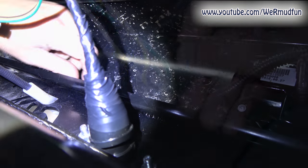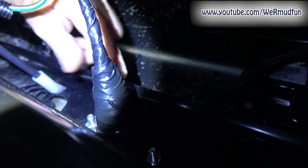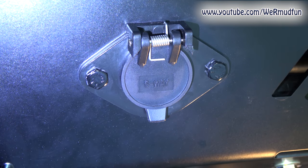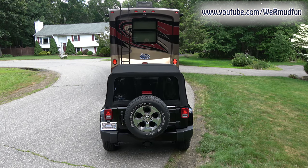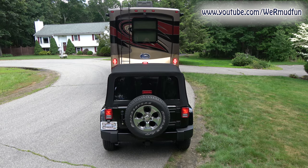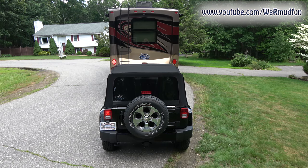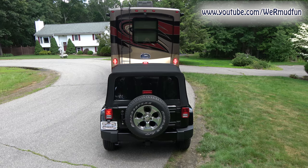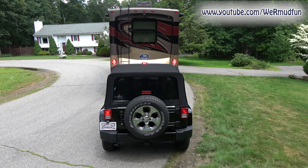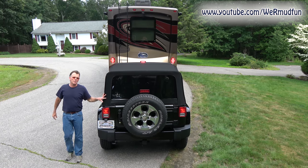That's our little cheat sheet — that's our finished product. It's all installed, the wire boot's on, it's all been taped off so we won't get any moisture, mud, or anything else down there. Everything's been painted and everything's mounted. Now it just needs to be tested: tail lights, brake lights, right blinker, left blinker, brake lights with the right blinker. It worked! All the lights work the way they should. Step three is now complete.